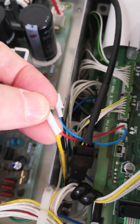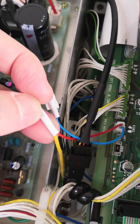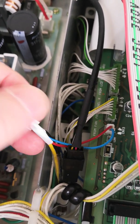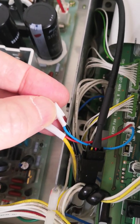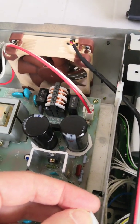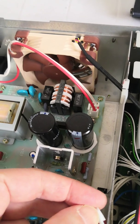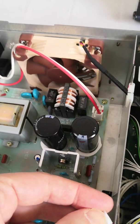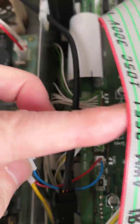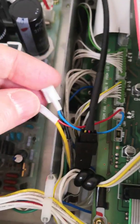So I ended up cutting the wires. Note: yellow goes to red, and black goes to blue — otherwise the fan will not work. The fan needs to come on as soon as you plug the machine in; there's no thermostat. It's on all the time and you cannot turn it off on the 2480, unlike other VS series machines.